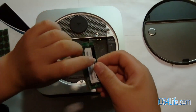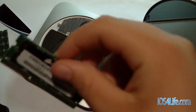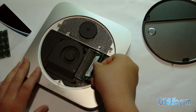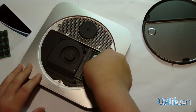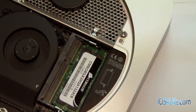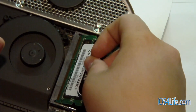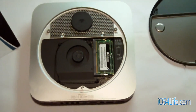Got our RAM out. Putting it back in is pretty easy — you just remember which way it goes; the indentation lets you put it in the right way. These are two 4GB sticks that add up to 8GB total. It originally came with 4GB total — two 2GB sticks. Put the pins in first, then push it down and you should hear a click. Then the top stick the same way — make sure it's fully in there and all the way down. Take the second stick, put it in, make sure it's all the way in, and push it down. Pretty much done with the RAM installation — it makes it that simple.